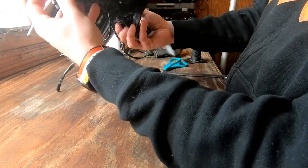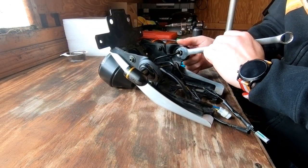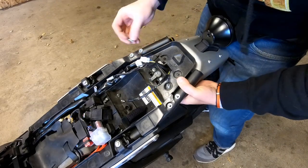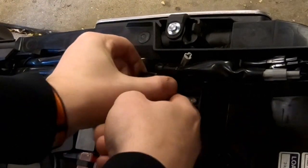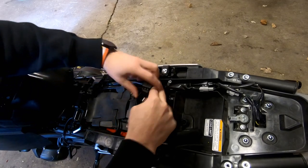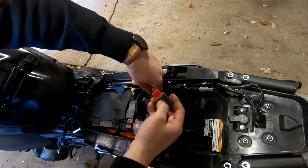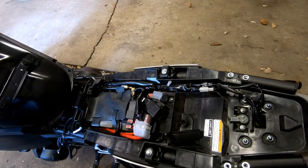At this point we're going to line the turn signals up and tighten them — the nut is 14mm. Once those are lined and tightened, put the trim back on, and the fender is ready to go back on the bike. Replacing the stock relay is super easy — it's right here. Just loosen it up and there's a connector buried in there. Stock relay out, then the replacement relay from TST goes in just like that. Let's fire the bike up and see what we're looking at.